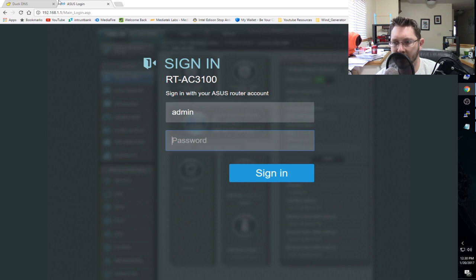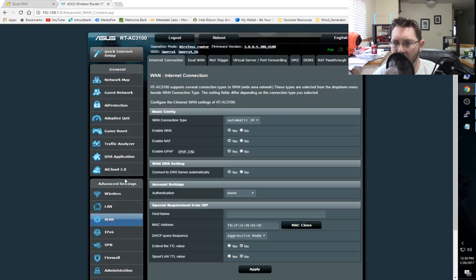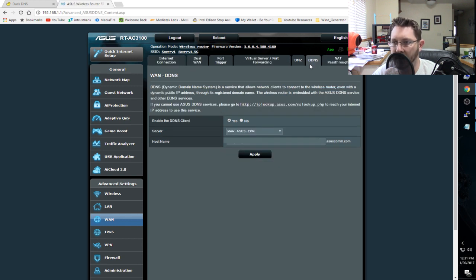I've got to remember my password. So I'm going to go to WAN and DDNS. See, I've got DDNS here. Okay, so I've got mine. There's that asuscom.com, and I hit apply, and that sets it up.